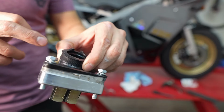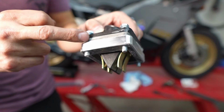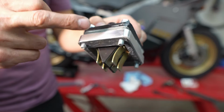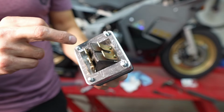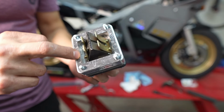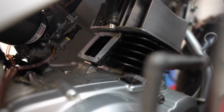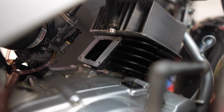Okay, so I have it assembled here. This is the carburetor boot. This is the reed holder here in the middle. Then this is the new Team Calamari Racing reed spacer. Then I have some more Honda Bond. Then I have the OEM Yamaha gasket. And then I have one more thin coat of Honda Bond on the actual engine. So let me get this all secured. I'm going to torque everything down to 9 foot-pounds again. And then I think we're done with this part of the install.